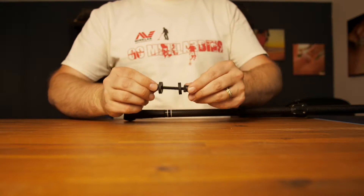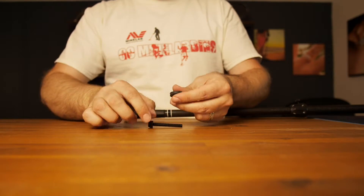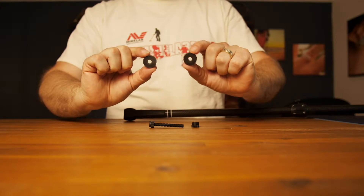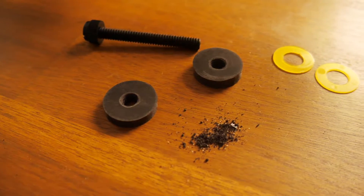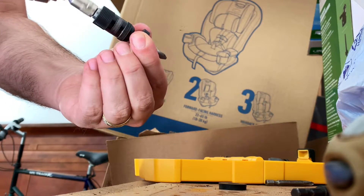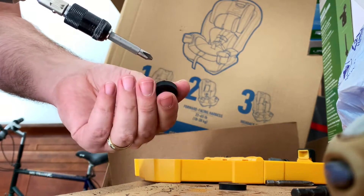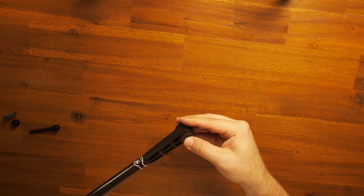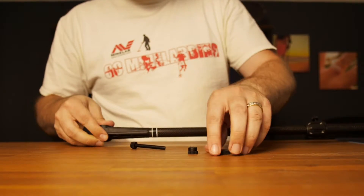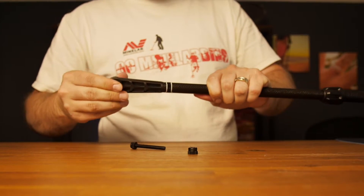Back to the tutorial. Now we're gonna finish assembling the lower rod so we can get the coil on here. Anderson does send the hardware — you've got your bolt, screw, and a couple of neoprene rubber washers. I did run into an issue with the fit onto the actual coil head; it was really tight. I actually had to drill out these neoprene washers just a little bit to get that bolt to go in smoother. When you insert it into the lower rod it compresses the washer, which made threading that bolt through much more difficult. We drilled those out and it fits a lot smoother now.